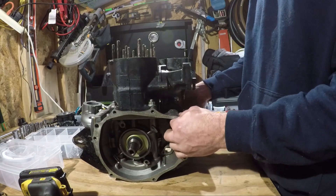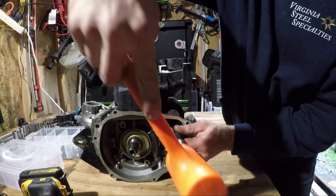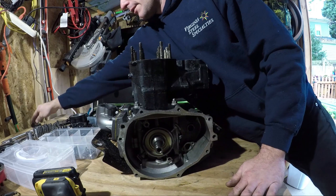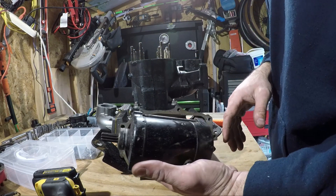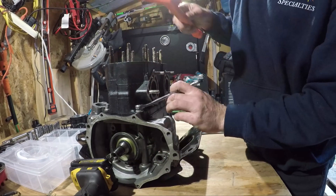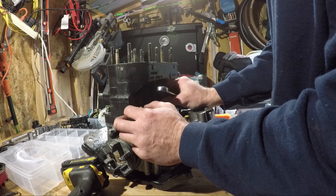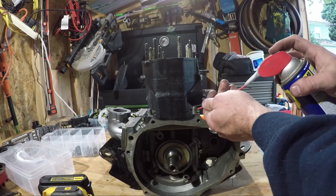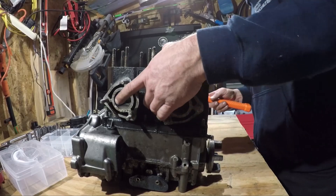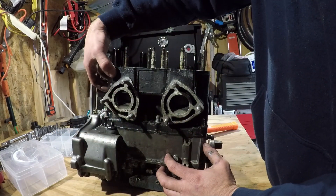The starter motor is another slightly stubborn part to remove. The key here is to use a drift of some sort and hammer on the starter gear. You shouldn't have to use much force, but it does take a few swings to get it to break free. The nuts on the cylinder body can be hard to reach — I chose to get them started with a six-point box-end wrench and a dead blow hammer. Once they were broken free, I applied some WD-40 to the studs to make removal a breeze. To break the body away from the lower case, shock the system with a dead blow hammer, hitting the thicker sections of the casting.